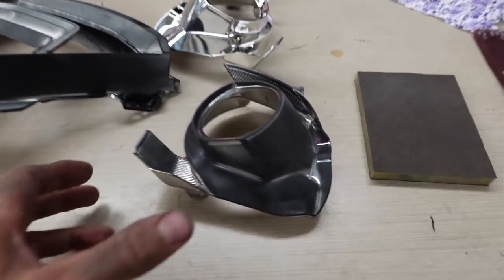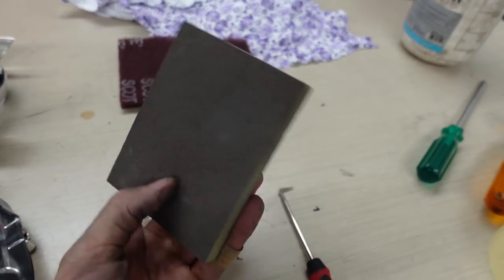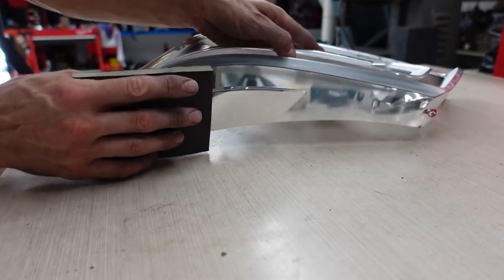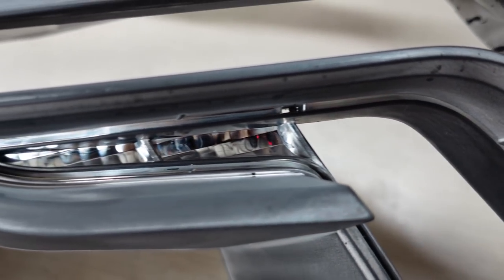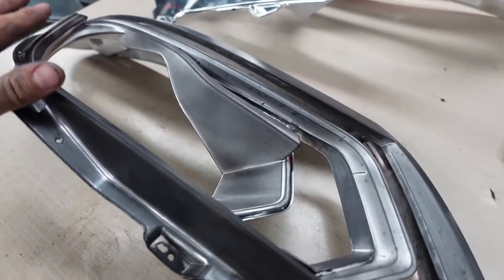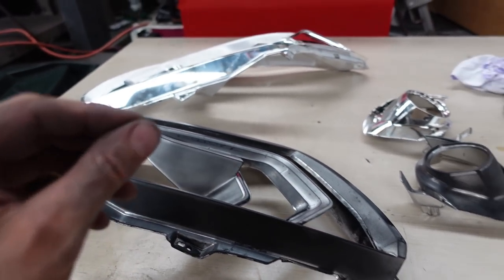I've just finished sanding back one set of covers and they're looking very dull compared to the original chrome shiny ones. I started with some Scotch-Brite but it wasn't really cutting the mustard, so I switched to UPOL fine grit flexible sanding pads — absolutely awesome because you can really get into all the crevices and corners. The aim is to have plastic that isn't shiny as much as possible. There is a reflector down in there that I'll tape up — I didn't sand that back. There's a product called UPOL Adhesion Promoter in a spray can that helps paint adhesion onto plastic or chrome components, but I don't have any to show you today.